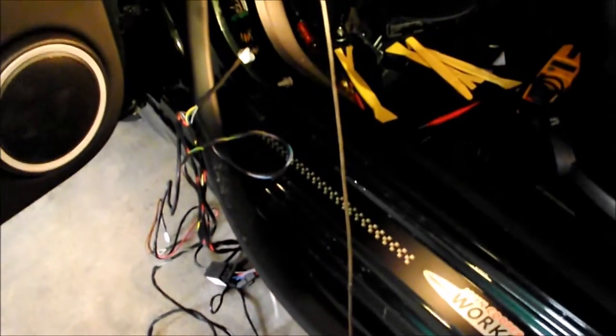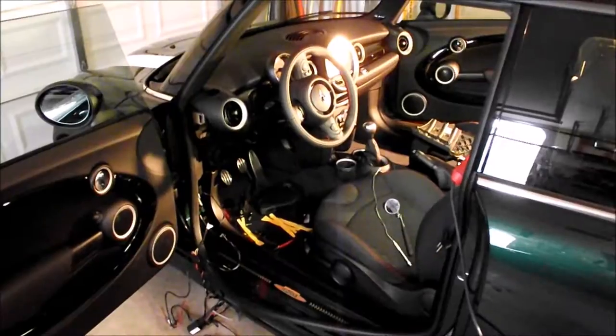To route the wire up to the switch I decided to use fish tape, but if you've got a coat hanger you could probably use that. I routed it from up here down to in here and then attached the connector for the switch with some tape and pulled it up. I routed the wire for this switch connector through this hole — that seems to be what the hole is for — and now I can connect the knee bolster switch.